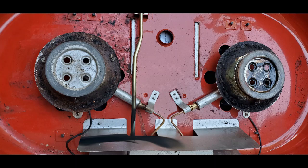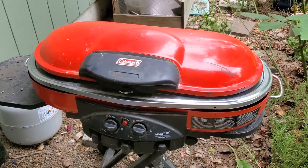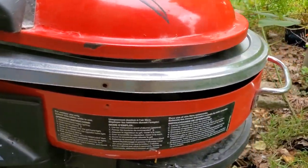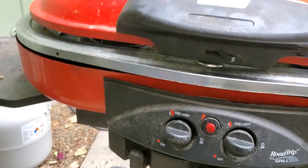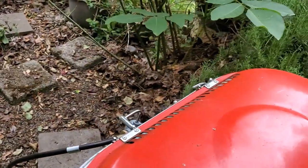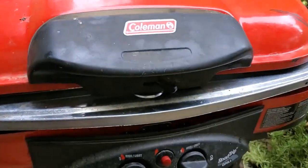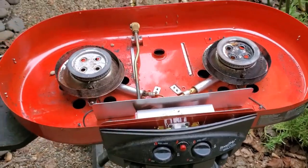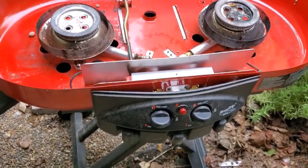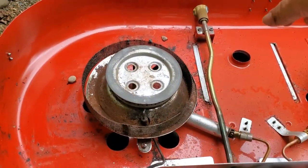After talking to Coleman, they said there could be spider webs in the venturi tube. I'm going to show you how this works now. The first step — I've already done this but I'll put it back — is to remove all the screws. On this model there are four around the side and two in the back, so six screws total. Once you remove those, the whole lid just pulls up and comes right off, giving you access to the inside.